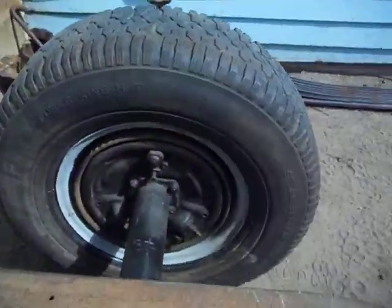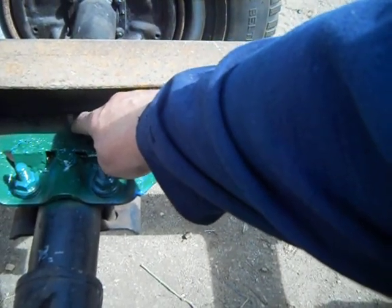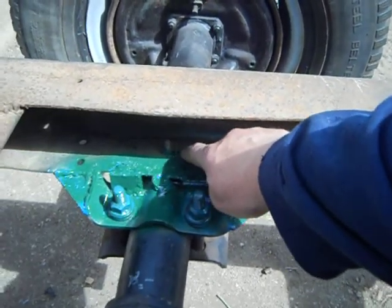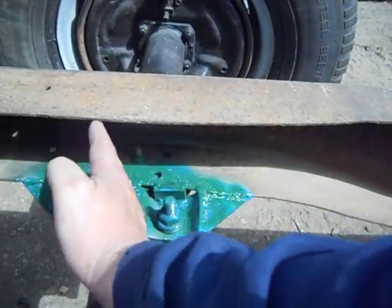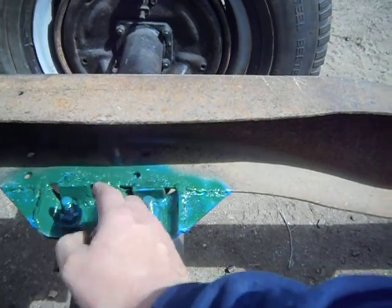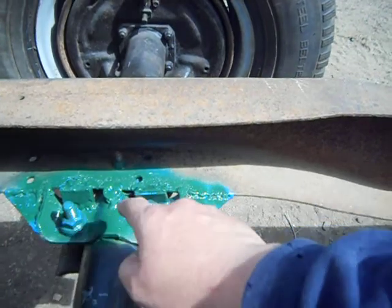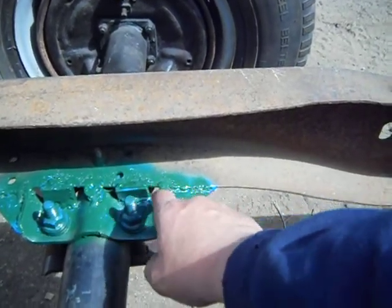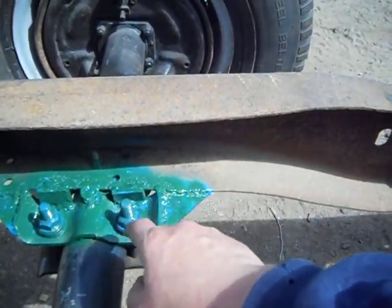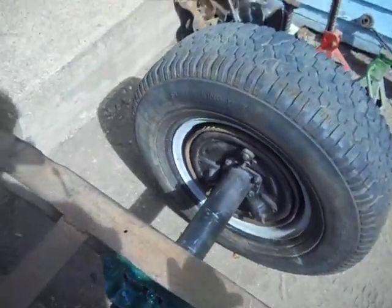In your little perch on your rear end, there's a hole because there's a pin that goes down through your leaf springs which centers it. I took a three-eighths bolt with a nine-sixteenths head and ground it off to fit in that hole. That keeps your rear end from going sideways on the leaf springs — they call it dog tracking if it slides. That helped line everything up to put these on here. I made actual gussets; I would not trust just a couple little blocks of metal tacked on. I made proper gussets — I thought I'd show some detail on that.